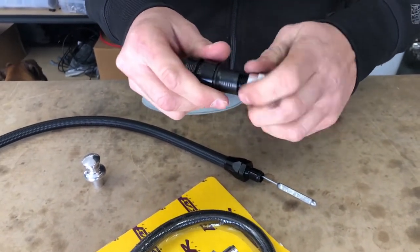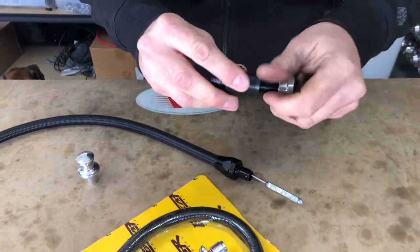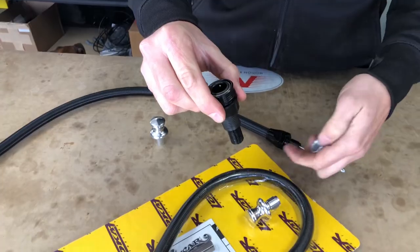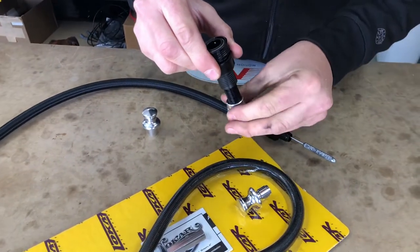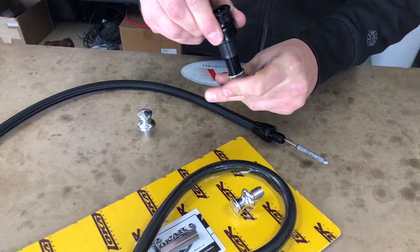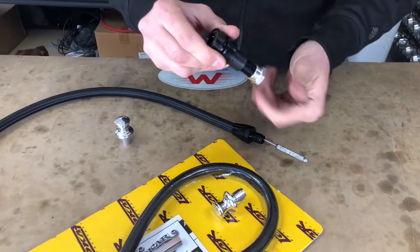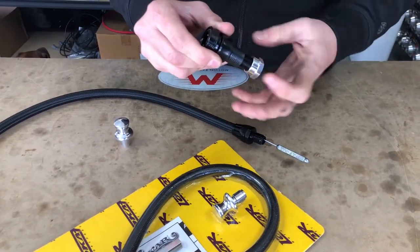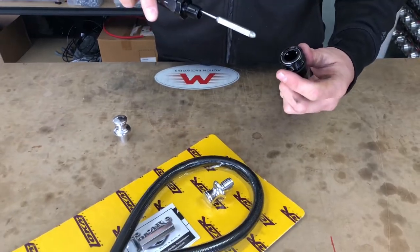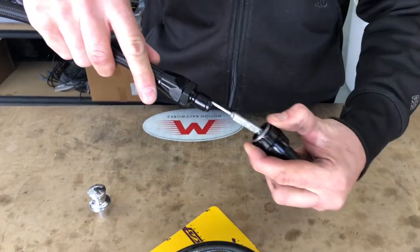The cool thing about this is there is a seal. If you take the pan off, this comes in from the top — take this nut off here — and this rubber seal will sit where the dipstick normally goes. You basically tighten this nut from the bottom, and what that does is create a tight rubber seal that doesn't leak ever, whether you're pulling the transmission in or out or if it's in the car.